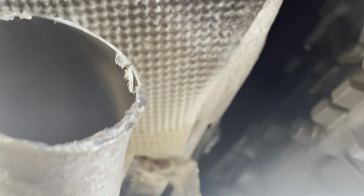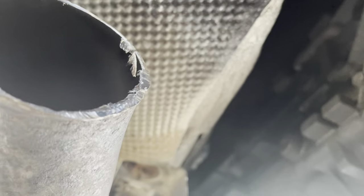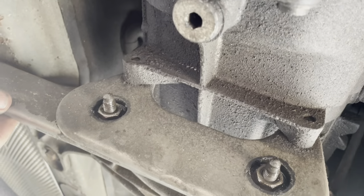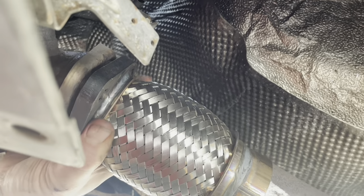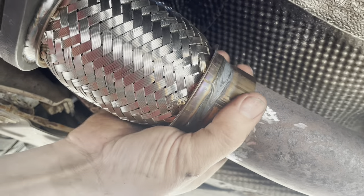I am going to have to dress this a little bit, because as you can see, the new piece when I offer it up fits that sleeve slightly over there. Because some of these sections here are still a bit sharp and lifted up where the old welds were, I'm going to knock those bits off, and at that point I can put the new sleeve over and then line it up with the nuts on the back of the downpipe. I've temporarily reattached these bolts to the exhaust, because what I've done is fitted the new repair section in place so these all line up with where they're going to need to be once it's all together on the car, just so I can take some tack welds onto this and actually line it up in the position it needs to be.